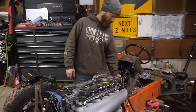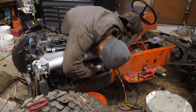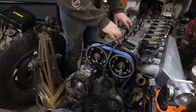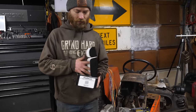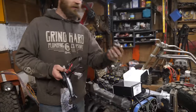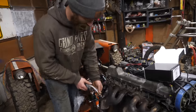I got the injectors all wired up — nice and tidy. We just need to get some split loom to cover everything up when we're done. There's a big bundle of wires going up underneath to the coolant temp sensor and the two knock sensors. I just finished wiring in the crank and cam position sensors, so that whole harness is secured so it doesn't rattle around. Next thing I'm wiring up is the wideband O2 sensor. Once I make an exhaust, I'll put a bung where they're merged so it's measuring off all cylinders.